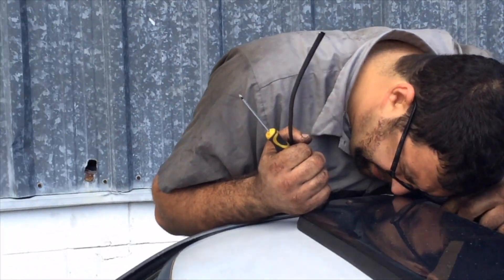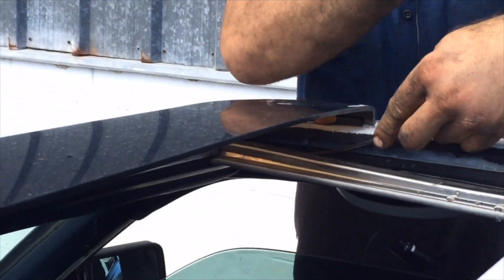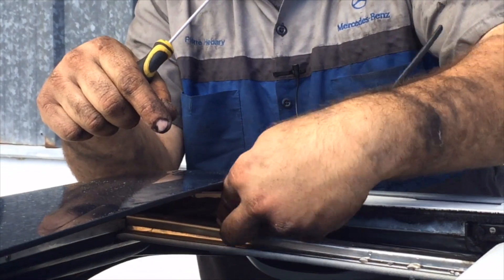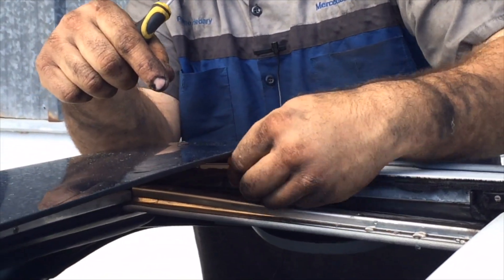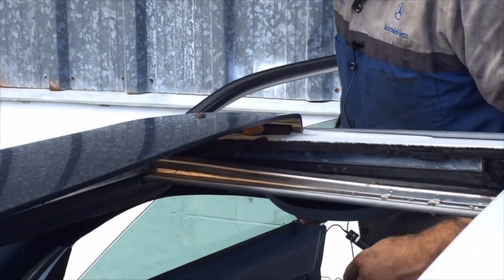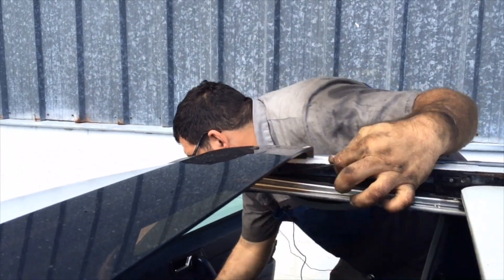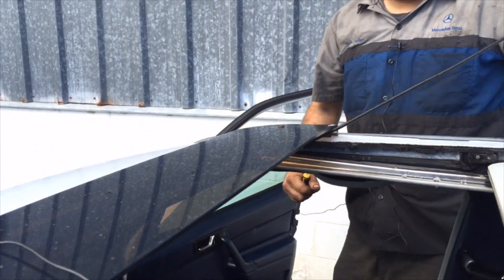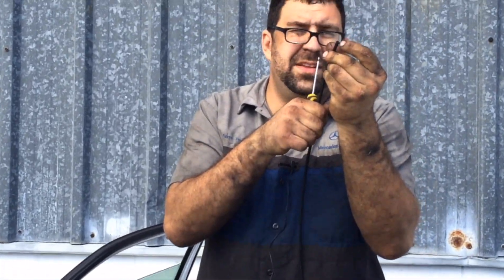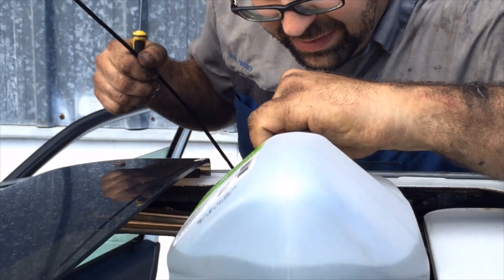In this corner you'll see a little hole, coming off at an angle on the inside of the sunroof tray. What you're going to do is probe the hole with the rubber tube. You can hear the rubber tube coming all the way through. The reason I like for this tube to be hollow is because it sort of picks up any debris or scum or anything like that.